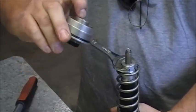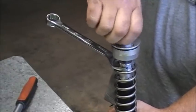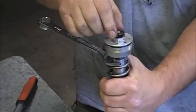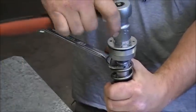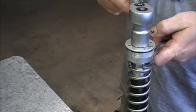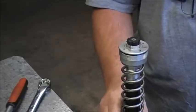And we've got to put our cap back on. There's a little o-ring up inside the top there and we want to make sure that this is seated properly. What will happen is this will screw down — when it reaches the top, you'll feel it stop. Then all you need to do is overcome the little bit of pressure that you put on the bottom of that thread and then you know that that's seated. You want to be turning the inside nut of the preload adjuster — otherwise you're going to possibly turn the preload adjuster and then it's going to just move the adjuster and not the nut down. Then we just wind that down and we know it's at the top until it reaches the hydraulic nut, and then we're going to tighten it up. There is a torque setting for this — I'm not sure where it is but I always just do it by feel, but it'll be in your manual should you want to check it.